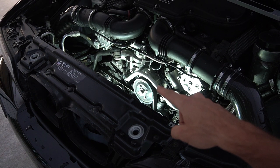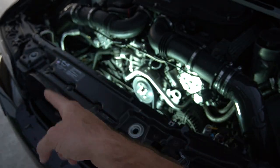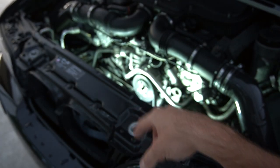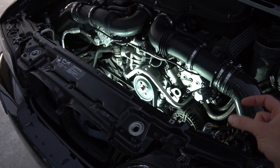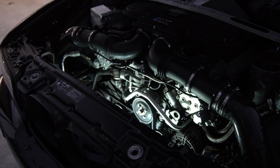So I'm gonna take this SAP system out. There's a pump over here. There's a line that goes to the pump itself and the bumper, which I already removed. But I'll take this hard line and this little other, I think it's some kind of valve or something. And then I've got Speed Haven plugs that will go into the block. There's one here and there's one over here. Really good opportunity to go ahead and knock that out.